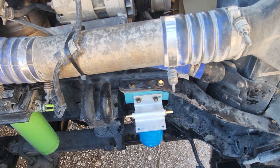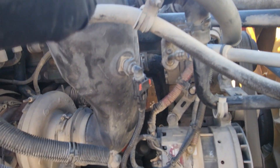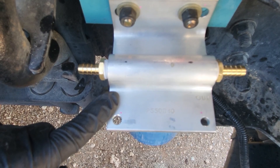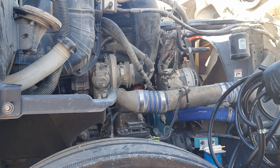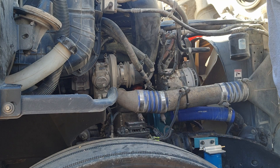The next step is we're going to get this coolant line right here — it comes out of the thermostat housing right up there, comes across, and goes in there. So I'm going to get that line and probably bring it up down through here somewhere. There's really no way to mess this up — it's in and out. Obviously, in is coming from the engine and out is going to our tank. I went and bought some new hose because my other hose wasn't going to reach, and I'm going to start routing this to where it needs to be.